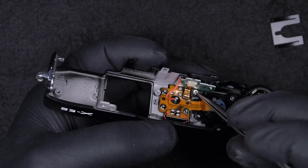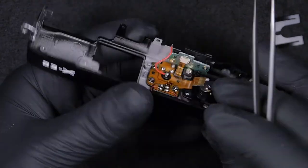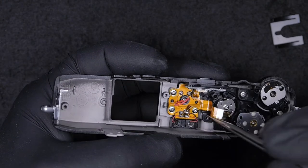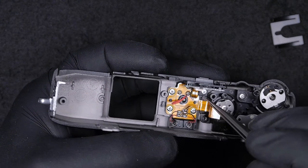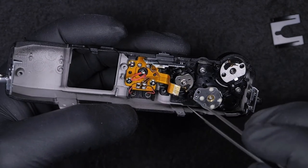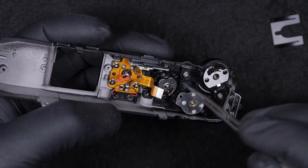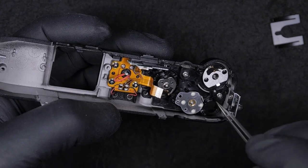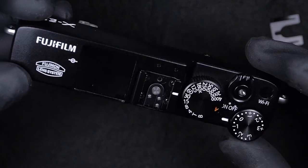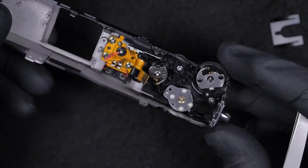It's better if you open up this and release it to have more space, and then you will need to disconnect that contact points, even the one in the middle, this one. So plus these screws, and yeah, you're gonna be able to replace it. These are very rare occasions where you need to replace it. If you want to replace the whole, once you took all the dials out, you can also replace the plastic thing over there. And pretty much that's it on the top cover.